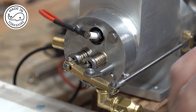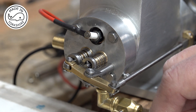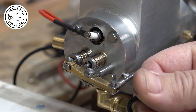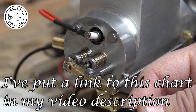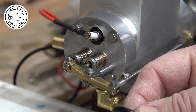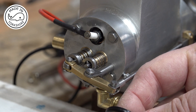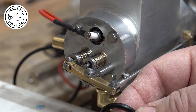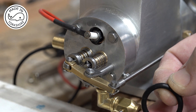In terms of piston rings, I think I've come across a significant problem. The drawing suggests using Buna-N rings, which are actually nitrile as I understand it. When I first tried getting this engine to run I used methanol as a fuel, and I found out by looking at a compatibility chart that methanol and nitrile just really don't get on together. The drawing also suggests acetone — acetone dissolves everything and it doesn't work very well with nitrile either, so that's out. And Coleman fuel — I don't think they get on very well with Coleman fuel either, so I've decided to get some Viton O-rings.